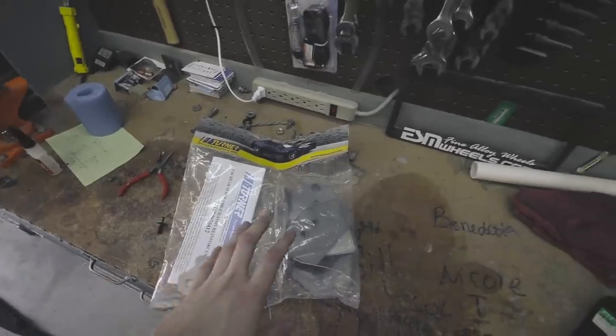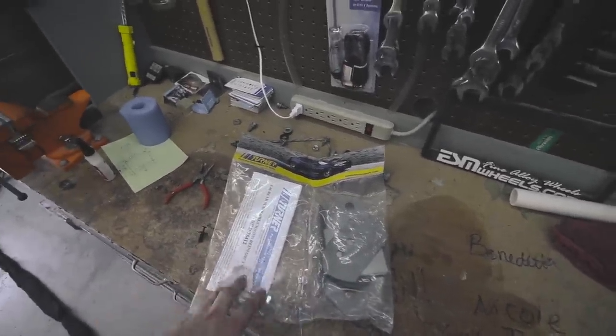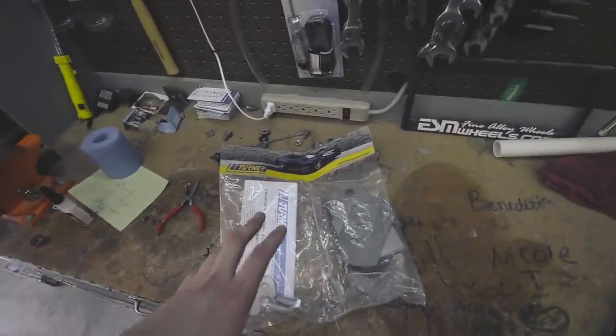What I'm going to do is drop the entire subframe of the car — all the suspension components, the muffler, the fuel tank, everything — to get access to the mounting points for the subframe. I'll be able to inspect each of those, and wherever there's a crack I can weld it back together and weld on reinforcement plates. This entire process is actually sponsored by Turner Motorsports, who sent me their reinforcement plate kit for the E46 M3. The kit comes with various plates, some spacers and bolts to hold each plate in for welding purposes.